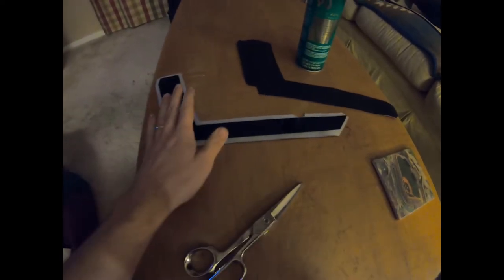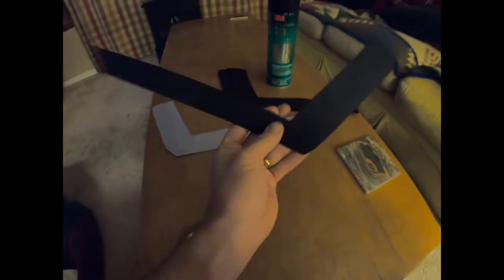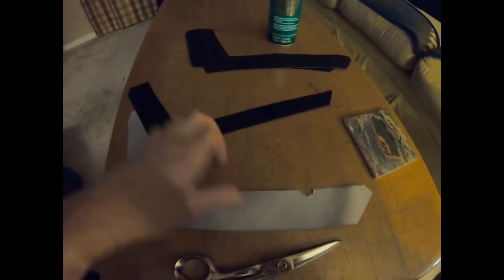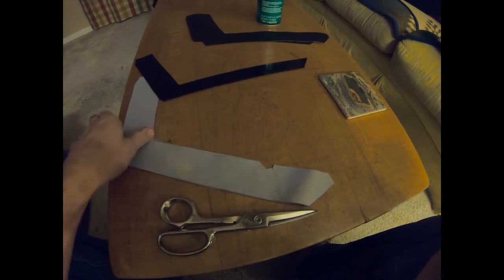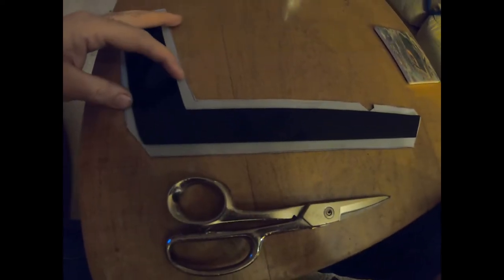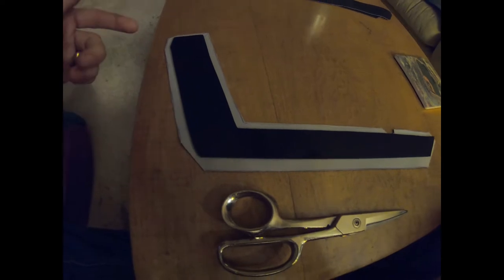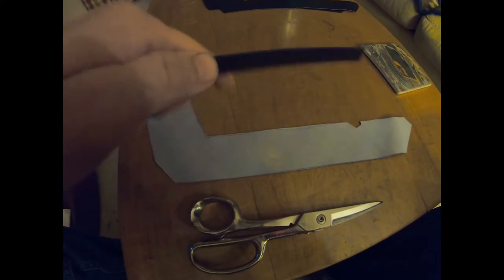Okay, we won't do these here since this is the living room table, but here are our plastic pieces, the ABS. I put the textured side out just to keep you on track to make sure one's opposite of the other. And we have our vinyl right here. I know we have a notch there, but I was trying to use as much as we could of a scrap piece I had. Basically you lay this right in the center of it, and we left about a quarter of an inch all the way around. We can move it up here so we'll have enough wrap here. We'll do our little relief cuts like we have on the door panels and on the dash pad, but first we'll just worry about gluing this piece to this here.